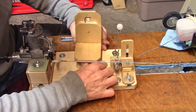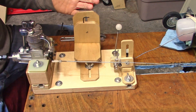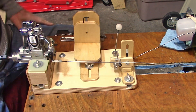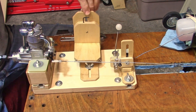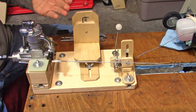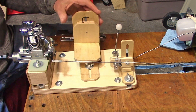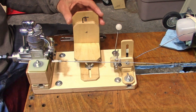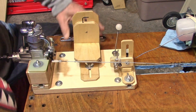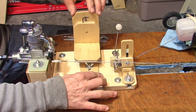That setup already didn't seem like it was going to stay in place. The other thing — Florida Floyd sent me a video of him running a Super Tiger S75 engine on this stand, and as it was running, the stand was just shaking and vibrating. That's not a good thing because it can cause foaming in your tank. And if it's going to vibrate that much with a single-cylinder two-stroke engine, which usually has very low vibration, what's it going to do with a four-stroke engine, especially up to a 120 size? That's potentially a weak spot. I'm not sure if this is even quarter-inch or three-sixteenths thick plywood.